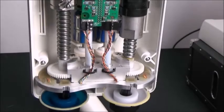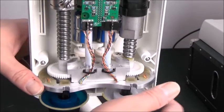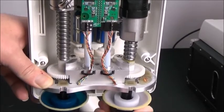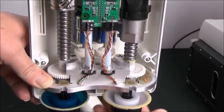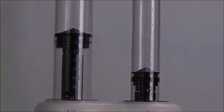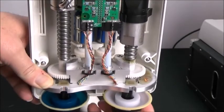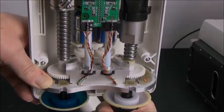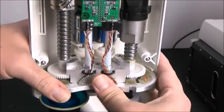Slightly pull out the metal plate that the drive gears are attached to, but only far enough to separate the blue potentiometer gears from the transfer gear it touches. Using the manual knob, move the syringe plunger that needs calibrated to 50 milliliters in the syringe. Be careful not to turn the blue potentiometer gear while doing this — we need it to stay at 50 milliliters. Push the metal plate back into the housing to re-engage the potentiometer gear and the transfer gear.